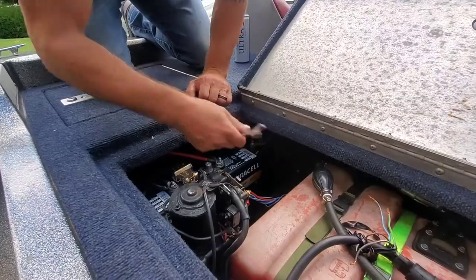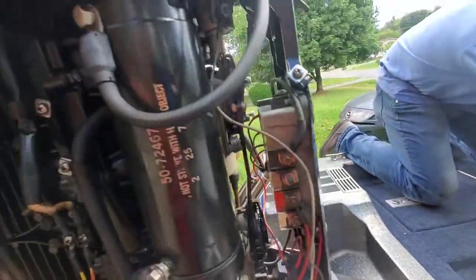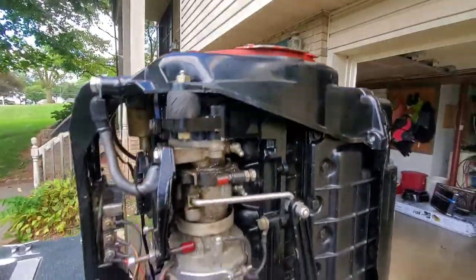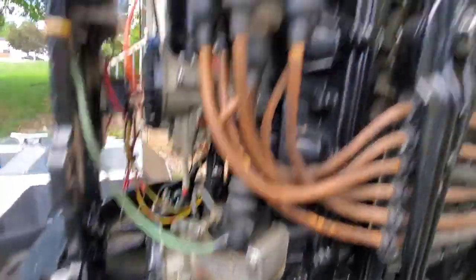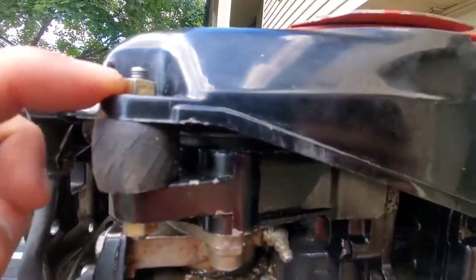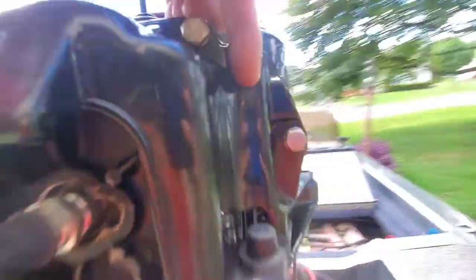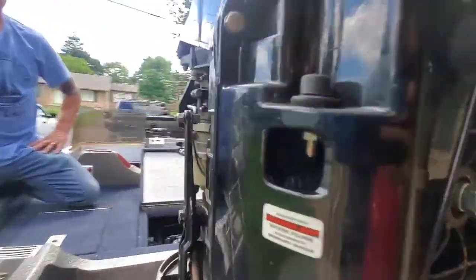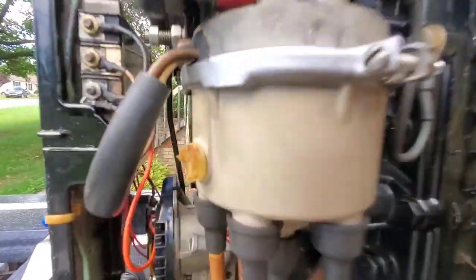We're going to disconnect the battery — it looks like a size 13. Before we get into the actual replacement and alignment of the distributor, that way we can get everything timed properly. Power is disassembled. We're going to start removing the shrouds — we got a size 11 here, and then 11 metric going all the way around on the back. We're going to pull this off, then pull the choke solenoid off, and that should give us exposure to the distributor right here, which has a bad trigger.